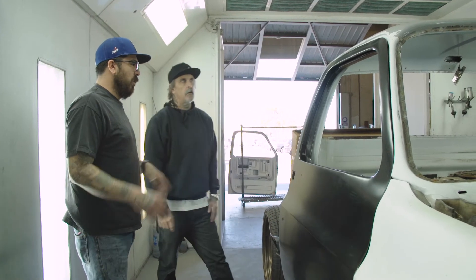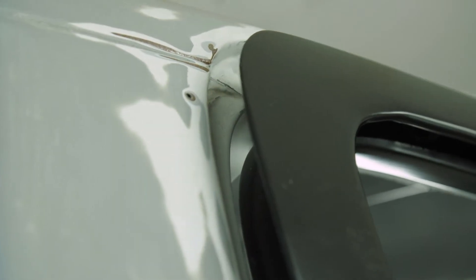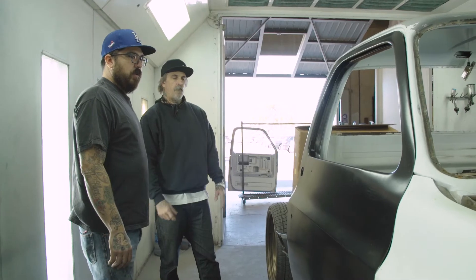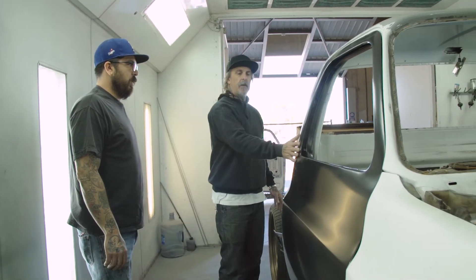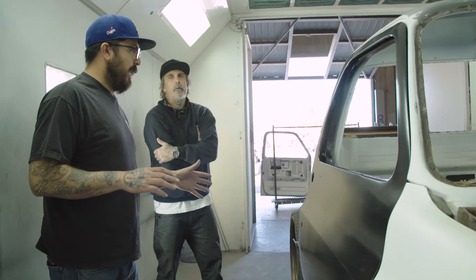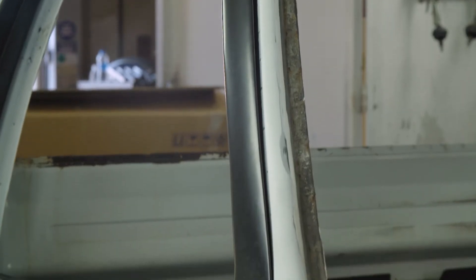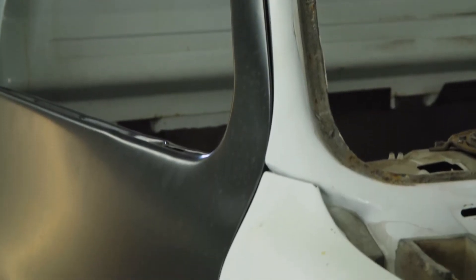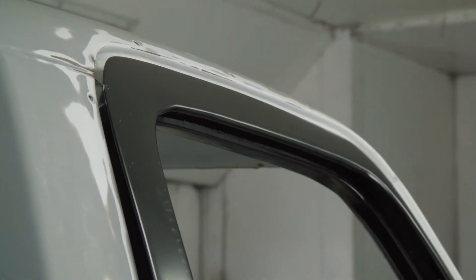Technically you could almost fit this door by bending it. And that's not what you want to do — because once you start putting in components like windows and window motors, that can all change by just opening and closing the door. So how far do we want to go fitting this door? We've already shown it's going to be difficult — that's just to fit it. Then you've got to bodywork it, put the latches in and all that. And if it changes at all by taking it off to paint, you're going to be chasing your tail. Then you have to do this again on a painted surface.